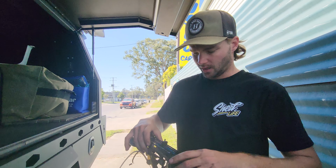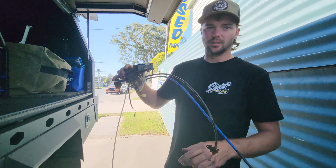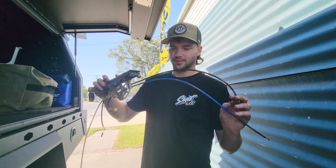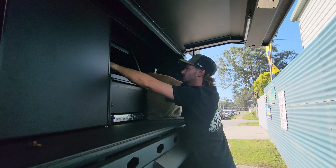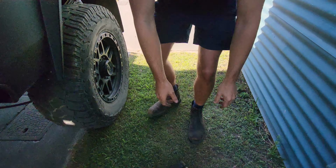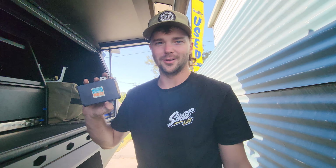We are good to go. So we've got, we didn't need this part, but we needed the cables. Toyota wouldn't sell just the cables, and this bloke wouldn't sell just the cables either, so he grabs the whole thing with the cables. So we tick that one off the list. We also got the heater tap for under the bonnet. We also got our timer that does not exist under the dash. That's why I cannot find the glow plug problem, because the timer was missing.